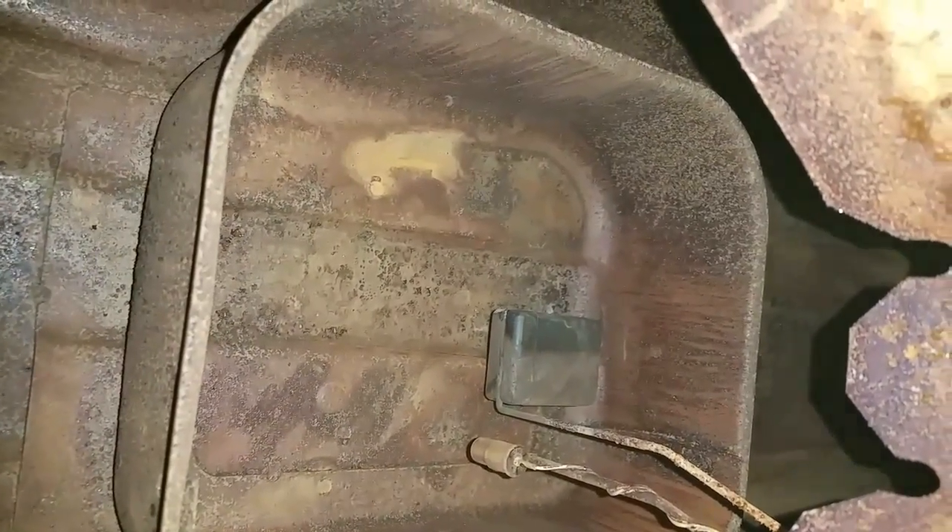What the pan is for is your fuel pump sits in the bottom of this pan. And as you go and get gas on a daily basis, you get rust and sediment and junk out of this pan, or out of the gas pumps and out of the ground. That pan separates all your sediment, so instead of pumping it all into your fuel filter, it gets sorted and left on the outside and the gas goes to the inside.